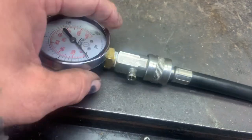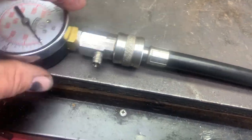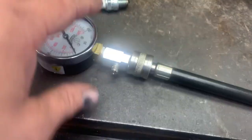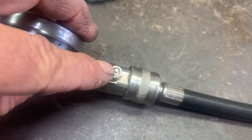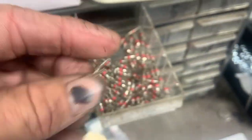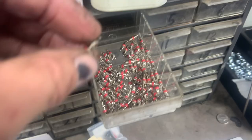It just releases pressure and I'll leave the little button off of it. Mine was leaking. You can force air in here with a blow nozzle and spray soapy water — and I had a leak right here. Since that's just a Schrader valve out of a regular car tire stem, I came over to my Schrader valves for tire stems, took the old one out, put a new one in there, and boom — the leak is fixed.